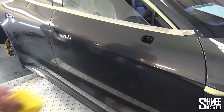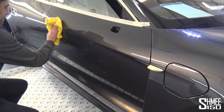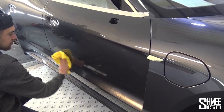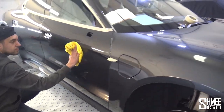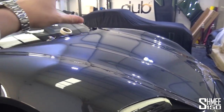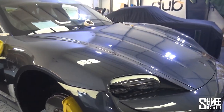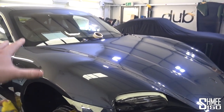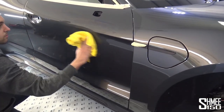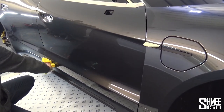The last part of the panel prep is to use some surface cleaner to make sure that nothing is left, because any dust or anything on the panel will show through the vinyl — you'll get a significantly amplified effect due to the way it works. Prior to that, everything has been clayed, completely gone over to get rid of any waxes or materials left on it — for example, at the dealership, often used to hide paint defects. Obviously in this case you want the smoothest, perfectly clean possible panel to start working from.